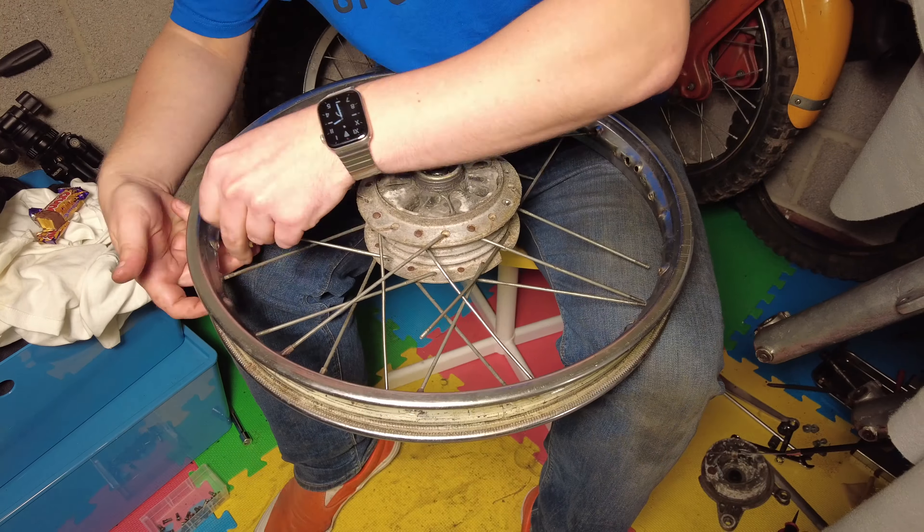With the compression looking good, the next thing I want to do is replace the wiring to the generator, because it's all frayed and pretty horrible. At this point I encountered lots of JIS bolts whose heads have been rounded off by Phillips head screwdrivers. Drastic measures were needed to get some of the heads off, and then I'll go around and replace them all with Allen key bolts. Got the little bastard — that took a lot. I managed to break a couple of flat head bits. So here is our high-low gearbox mechanism — I'm going to take the cover off here to get at the generator.